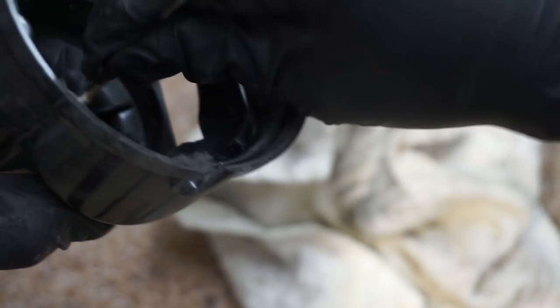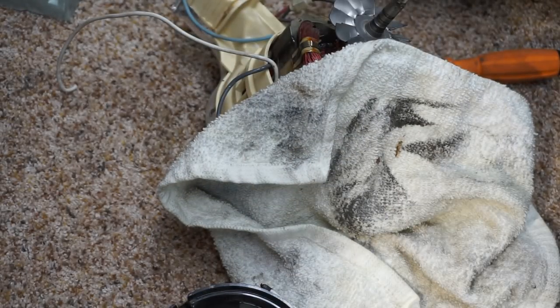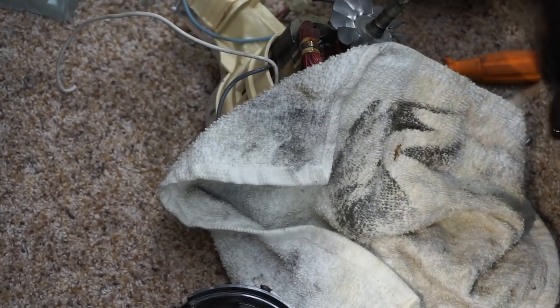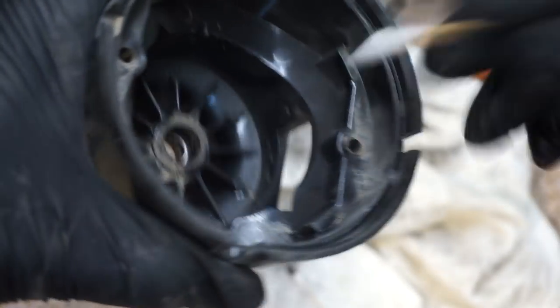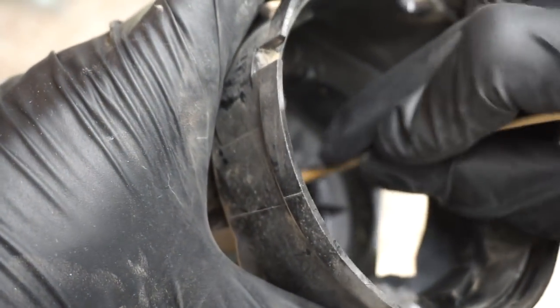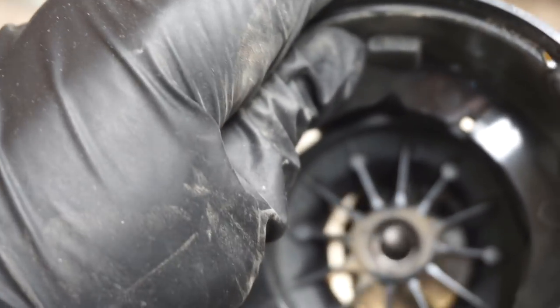Roller bearings like that excel at taking forces that pull laterally, am I using my terms right? So the belt tension pulling sideways on the shaft, the needle bearings are very good at taking up those kinds of forces. It's a very appropriate bearing for the application. I've often thought needle bearings might be better in a brush roller. I kind of agree. Some of the weaker parts on vacuums are usually the bearings. In motors, other than carbon brushes, they are the thing that goes. In a good, well-made motor, the bearings will go out before the motor burns up.